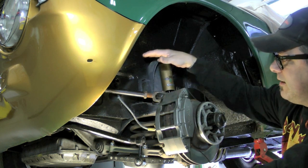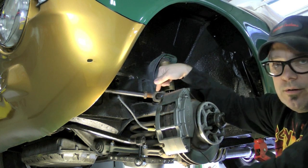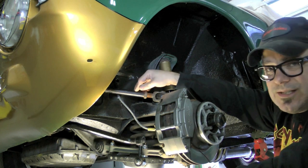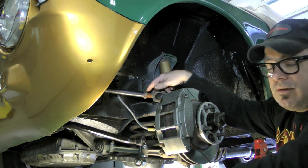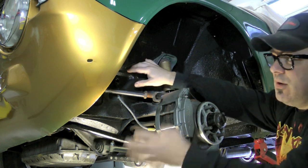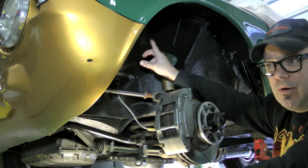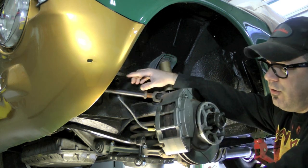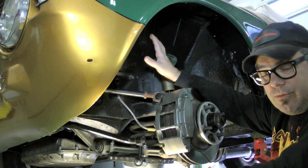What I'm going to do is take the upper control arm off and take the caster and camber mechanism out. I need to re-center my caster arm because I have almost all the thread exposed on one end and very little thread exposed in the front - it wasn't centered before I put it on the car. I'll adjust the camber using a tool that tells me the degrees. I've already set up the other side at 1.25 degrees of negative camber with 40 millimeters of space from the fender to the tire, and this side needs to match that.